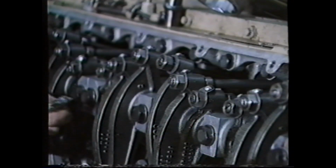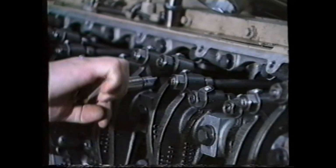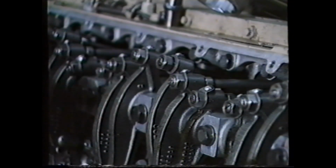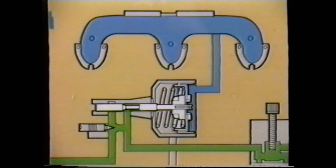If there is no problem in this area, next check the injector adjustment. You will recall that if these are set long, the injector will inject more fuel. Remember also to check the injector specification. If it is found that the black smoke is only evident on an initial engine pickup, and you've confirmed operation of the AFC, this is an indication that the no air screw is incorrectly set, allowing too much fuel through on initial engine acceleration.